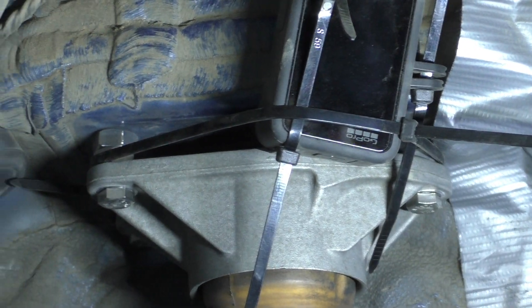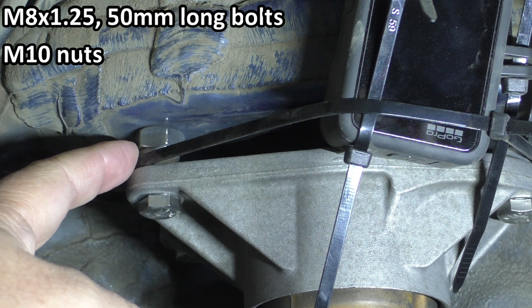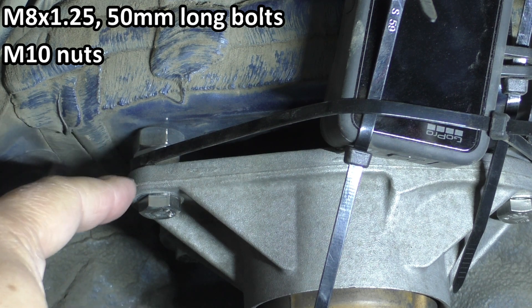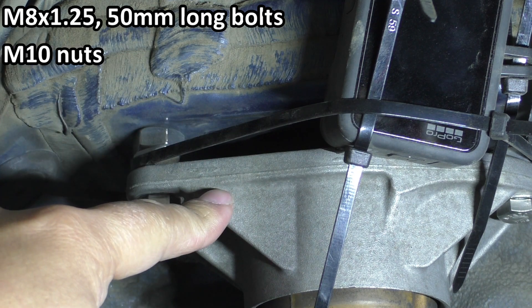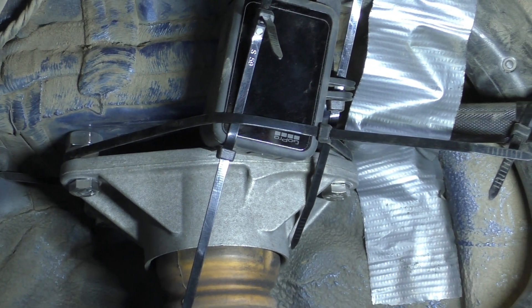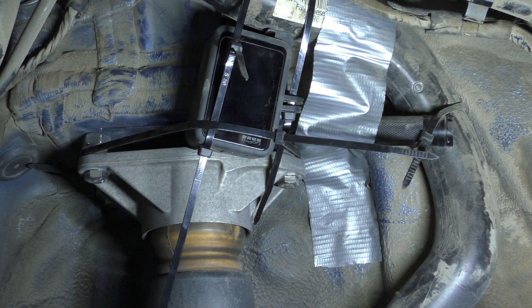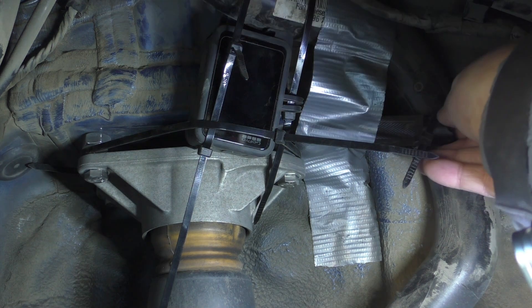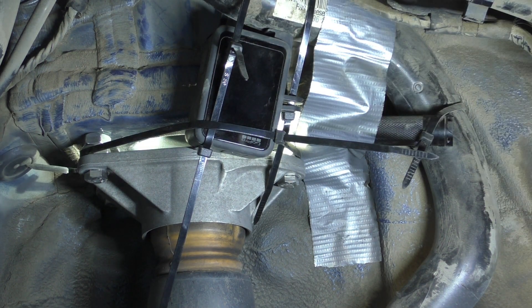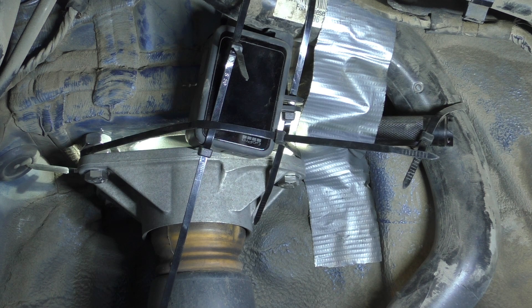To do that, let's take a look at this a little bit closer. What I've done is I just went to the hardware store, grabbed some M8 longer M8 bolts, used two M10 nuts to give myself a little bit of standoff between the body and the shock mount so that I can actually see with my GoPro in here. Then I just rigged up a mount system, zip tying the GoPro to the fuel filler tube. There's a problem though — it's dark in here and there's no light. So I had to rig up a light source too; luckily I have this tiny little flashlight which I could use to illuminate the area so that the GoPro can actually see the shock mount. I'm going to go ahead and take this on the road, hope everything holds, and see what kind of footage we get.